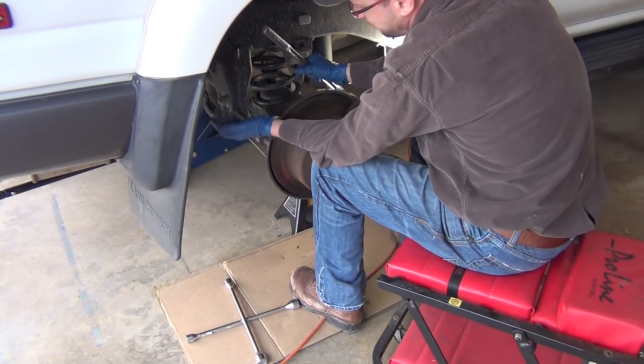So here's the caliper — I'm going to go ahead and compress this. It's a deep little piston. It's kind of what you would consider upside down for a piston, but you have to realize the pressure is coming from the top, so the dome of the piston is actually inside there. We're up inside the piston with this little tool, and we'll just push and compress that piston back down. It just goes down and it's pushing fluid back down.